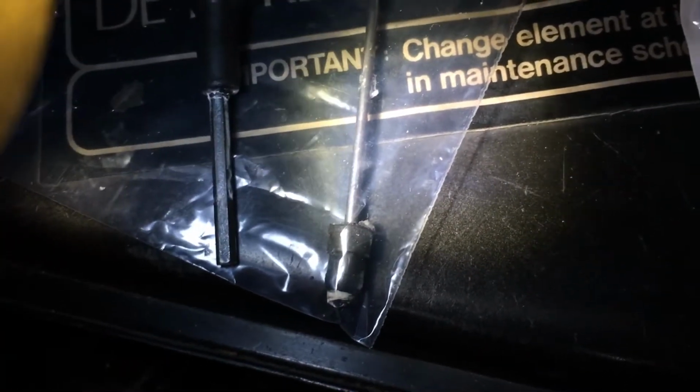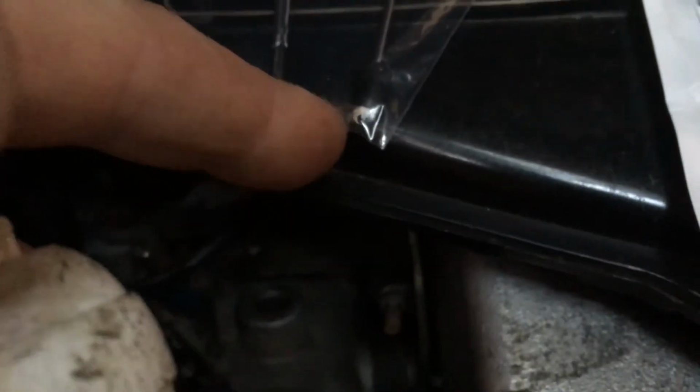It's meant to go flush to the top of this bung, so it's in nice and proper. On my DeLorean, the rod, where I've been in and out so many times, punctured a hole through, so I've been putting a bit of glue on the end, as you can see, and that in there was potentially causing air leaks. That's why I've got a new one in there now.